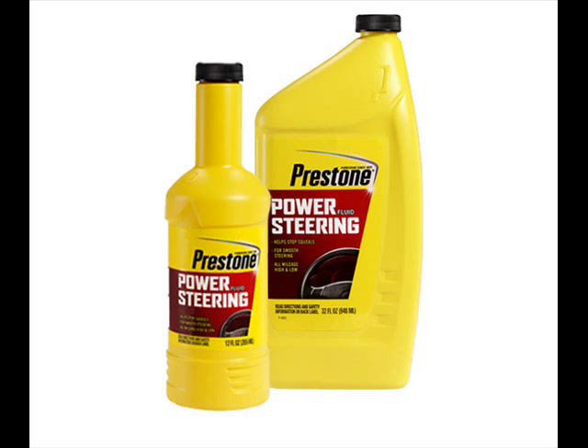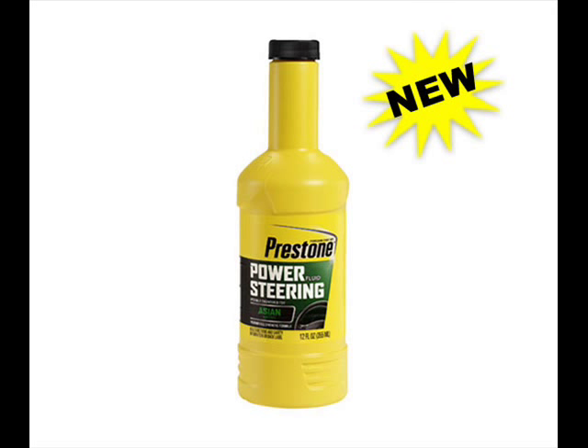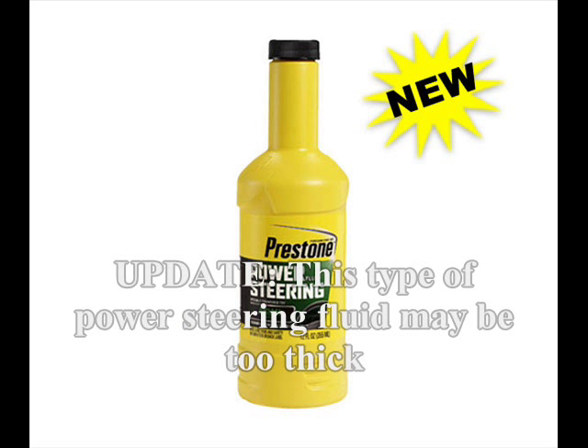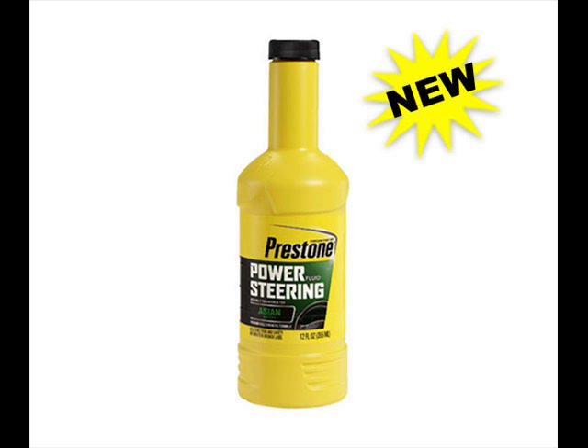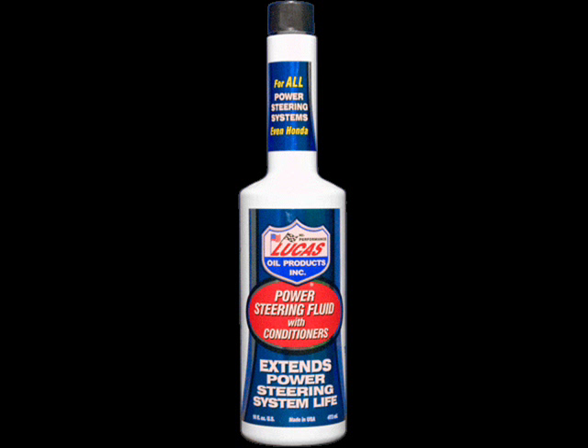The next category is where you'll find the best stuff: miscellaneous automotive fluids. Generally I recommend two things — power steering fluid and automatic transmission fluid, most often referred to as ATF. For power steering fluid, there are three different types: conventional, Honda type, and Asian type. The one you want to use is the Asian type — it has the highest viscosity and is closest to two-cycle oil. Next would be Honda type. I'd advise against conventional — it's just a bit thin. One good option is the Lucas brand power steering fluid, which actually has a thicker viscosity than all of them and should provide a little bit of extra protection.